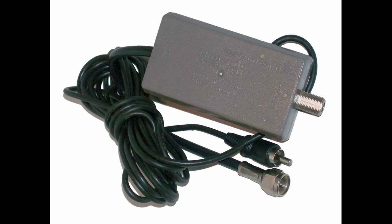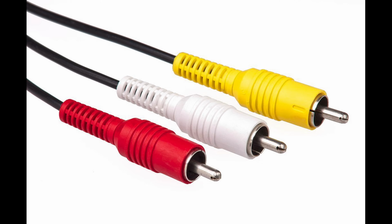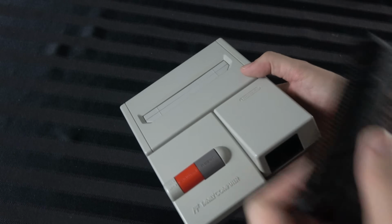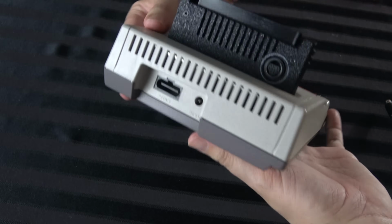When Nintendo launched the Famicom back in 1983, they obviously had a massive hit on their hands, but one of the things they didn't care about was future-proofing the video quality. The system launched with RF only, and really had nothing else under the hood. When they redesigned it for North America, they would at least give you composite video out of it, and then in Japan they would release the Sharp Twin Famicom, which had composite video, as well as the AV Famicom that also had composite video on it. Ironically, this is the same basic design we had for the NES top loader, except in our case they took the composite off and only put RF on it. Nintendo had this need to just make everything stupid.